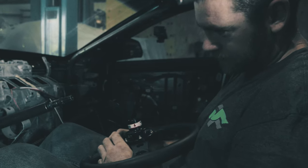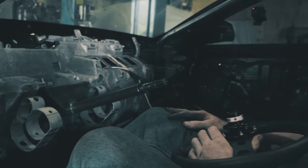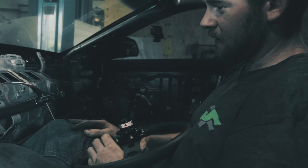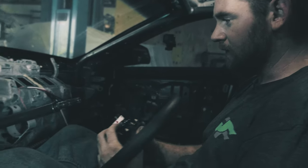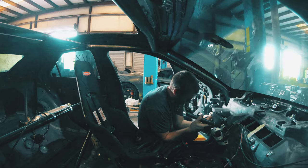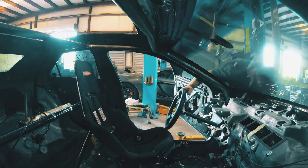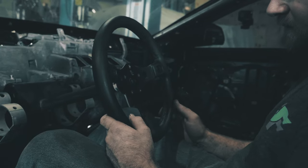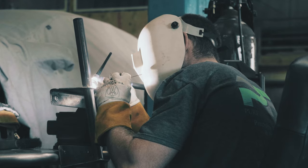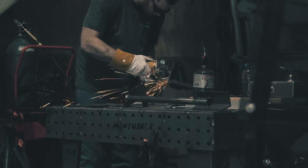Put him in the driver's seat after we got everything taken out. Got the interior and the engine bay shaft pretty much buttoned up close to where it needed to sit as far as length goes. Had him sit in the seat, made the bracket for where he wanted it, measured that, slapped it on, put the tube in. After that had him sit in the seat again and got the tilt where he wanted it. Once those tubes are made you can cut the tube to the length you want.